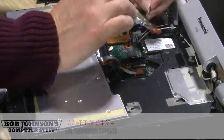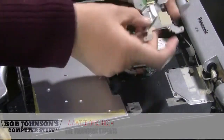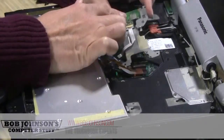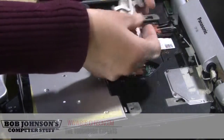Then your GPS is out of the unit. Just reconnect your Bluetooth. This is the same process if you need to replace your Bluetooth in your computer — you will do the same steps, and your Bluetooth board is right here. So if you need to replace that, you can just follow this same video.